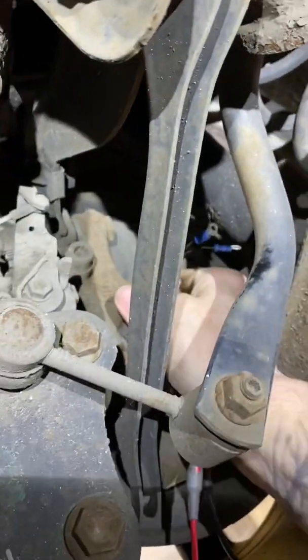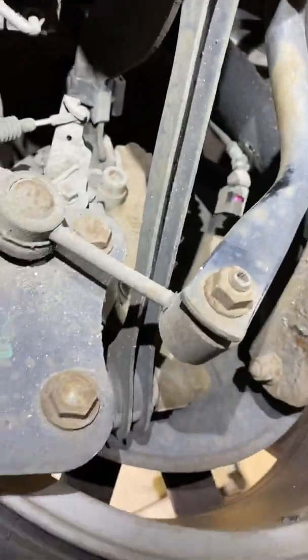I wouldn't expect to see it off limit. And this is the problem we have now with ABS sensors. A lot of them read differently depending on their construction. Varies from make to make. But we have got a difference. The most important thing is that we've got a difference. So there's obviously some problem there. Diagnostic data check on this car has told me that that near side rear ABS sensor isn't working. So I know the near side rear is faulty, and now I'm trying to confirm it to make sure it's not a wiring fault. Instantly we know now there's a difference between the two sensors, so we can safely assume that there's probably something wrong with that sensor.